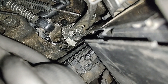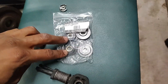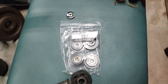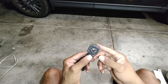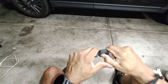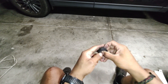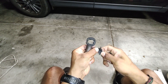This is my first time doing this without removing all the intake stuff. So these are the upgrades I got from Euro Tuning. This kit does come with bushings for both cable ends, but I'm just going to be replacing one because I already got the Diesel Geeks upgrade on the other. There's the slop. Now let's see if I can take this out without ruining it like I did on the other one — I broke one of the little arms. The fact that I could push that out so easily with my fingers — yeah, it's awfully crumbly.